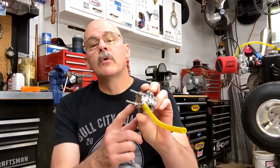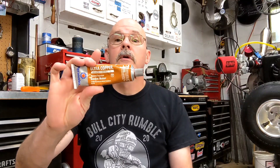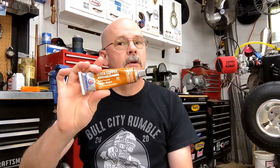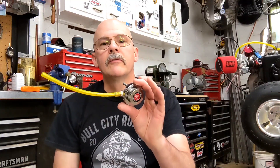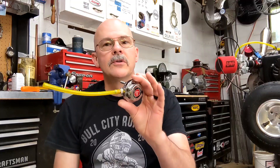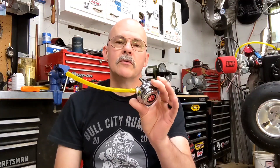So I got a pressure regulator, made mounts for it, and used sealant — this stuff right here — to seal it. Turns out somebody informed me this stuff is not good with gasoline, which I found out when it started leaking everywhere. So I've taken this off; I'm gonna hang on to it and may try to reseal it another way.